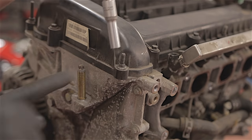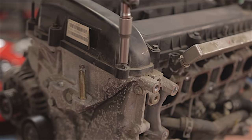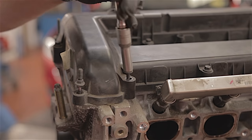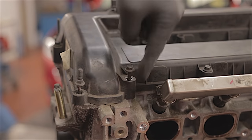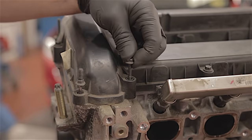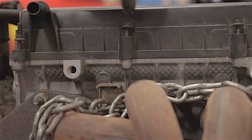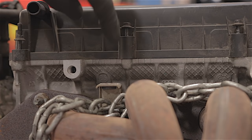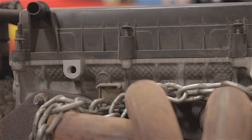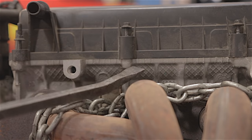You've now got something like 15 8mm bolts to undo. You'll notice that once you've actually unscrewed these little bolts, they don't come out — they're held in there by a retainer, which is pretty handy. One thing to remember here: when all your bolts are undone, there's a rubber seal between this plastic rocker cover and the cylinder head. The cover can get stuck to the cylinder head, so you don't want to break or crack it trying to get it off, because they can be quite stuck sometimes.